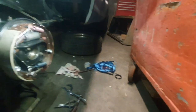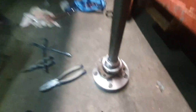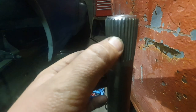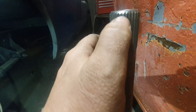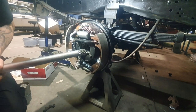I don't know if I have enough room in this space to put the axle in — that's my next dilemma, but I guess we'd better find out. On the topic of axles, I have new axles with new bearings. They could have cleaned up the retainer a bit, and they reused my old wheel studs, but anyway. Brand new axles — the end of mine were twisted. You can see these splines are all nice and straight. I only had about 5 to 8mm of engagement and it twisted these splines in the end, halfway between splines in the V section. So new axles it was. And there just so happens to be just enough space to put this little fellow in from this angle.